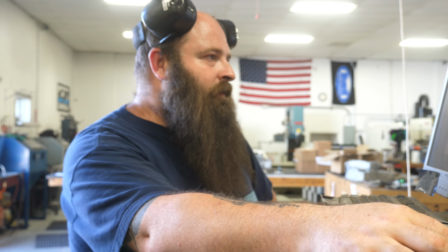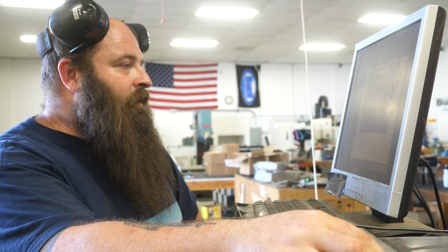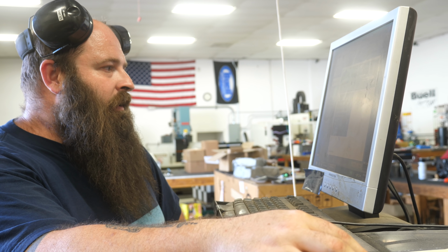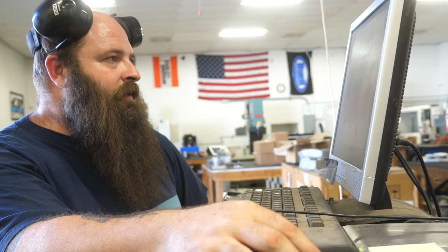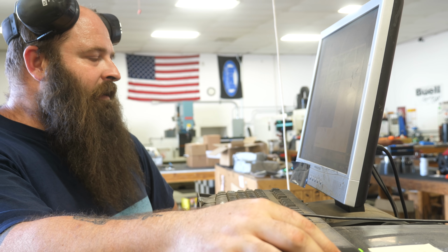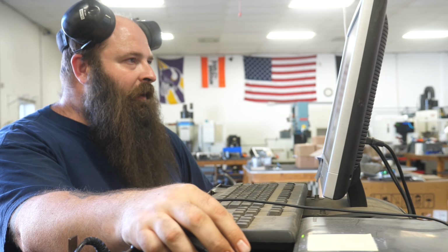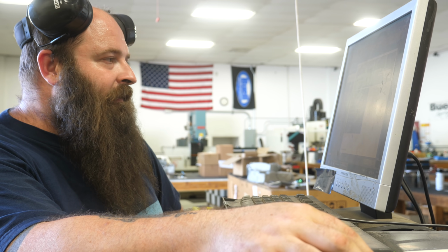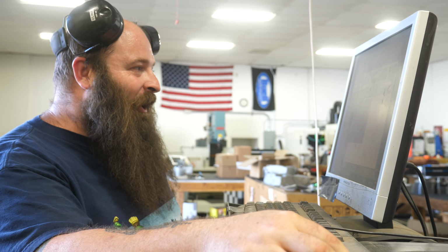Well, the first step is to make sure that we are reading spark every 360 degrees, not every 720 degrees, because it's a two-stroke. And so then trick number 2 is going to be to change my RPM on the dyno gauge here so that we have an idea, because it just hits 10 grand real easy and just stays there. So I'm hoping I can find the button to move that. Obviously, I don't ever need 10,000 RPM tuning Harleys. So if one of those turns 10 grand, we've got other problems.